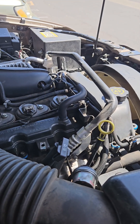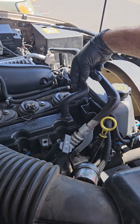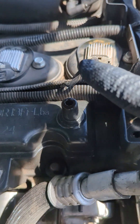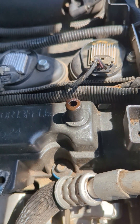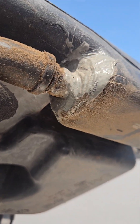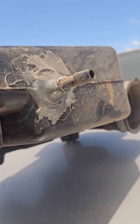The second concern is the exhaust-side PCV hose. This vacuum hose will harden and crack, allowing dirty air into the resonator. You may even find a dirty, muddy mess in this area on your vehicle. When performing maintenance or repairs that require removing the resonator, it will often get broken, exacerbating the issue — as seen here by the JB-welded one found in the junkyard.